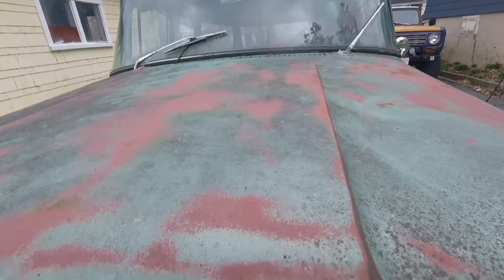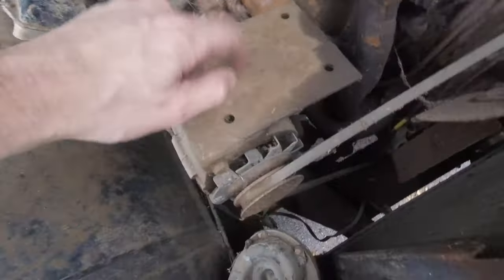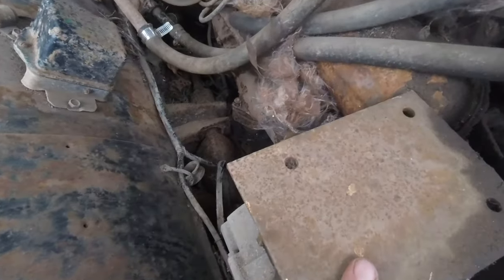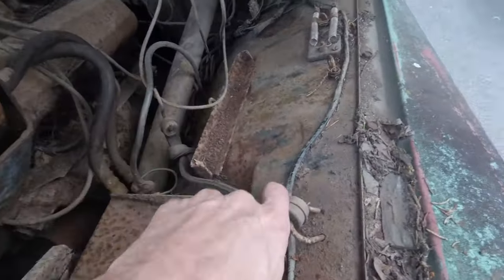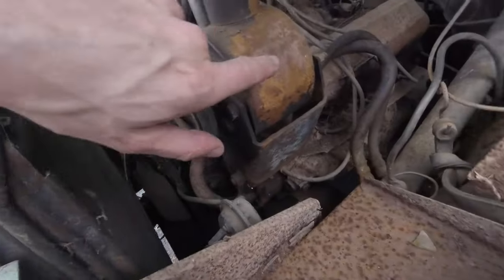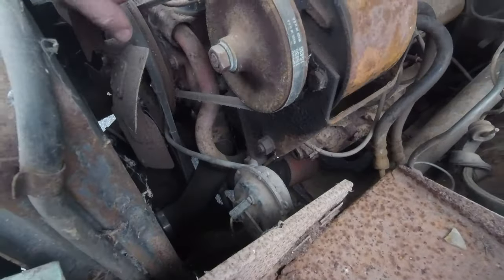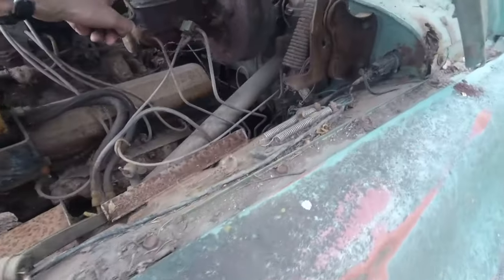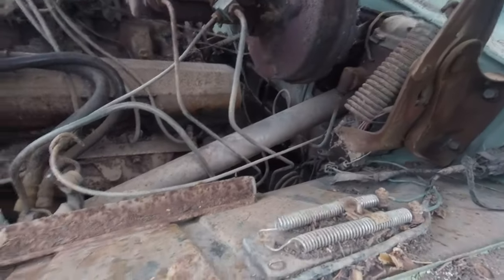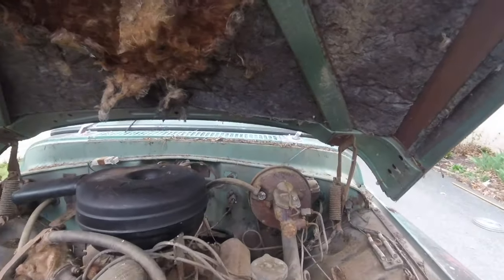Looking in the engine - it's a V8 of some kind. You can see somebody's been nesting in here. It's set up for AC and has independent front suspension, which is very interesting. The inner quarters look like they're in good shape on both sides. I'm going to have to pull this one out because it's got power brakes, but more importantly power steering. I'm going to pull this entire set out - all this bracketry, spare pulleys, everything - and put it on mine to give me power steering. Then I'll pull the booster out, rebuild it, and put it in mine as well.